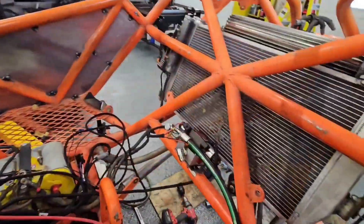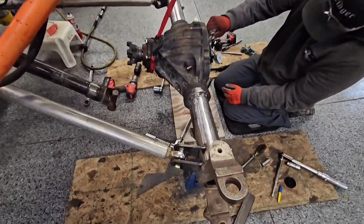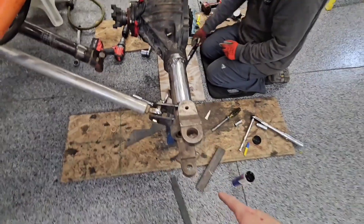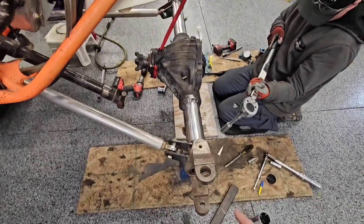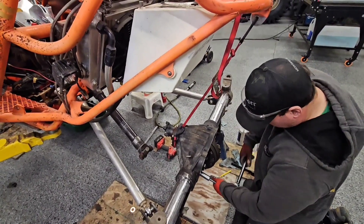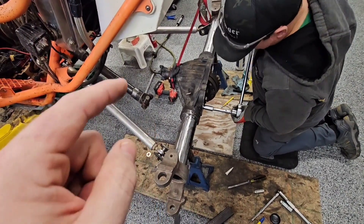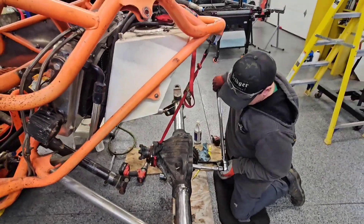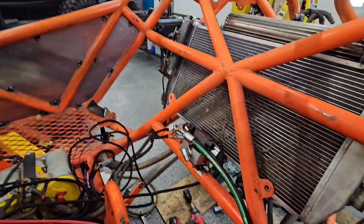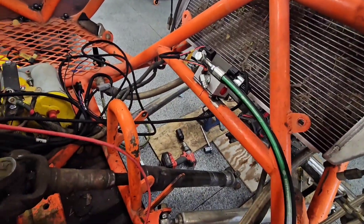The rear is going to full rear steer. It's got the Ford C's already on, waiting for the knuckles and everything from Busted Knuckle. Setting up the 4.10s in the rear currently. Still got to do an axle truss, link mounts, shock mounts, and coilover mounts for the rear — still lots of stuff to do.